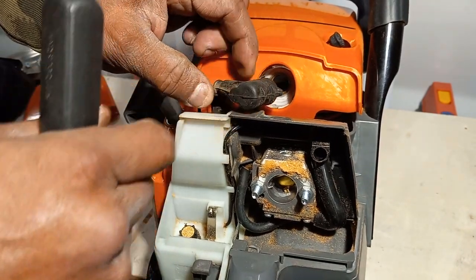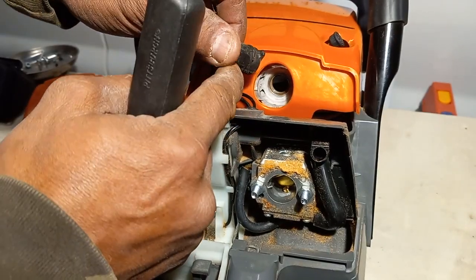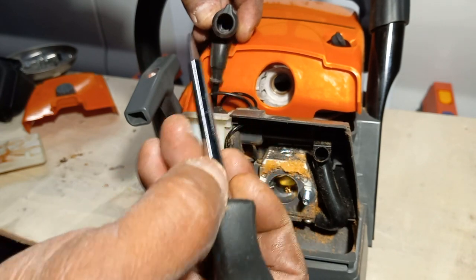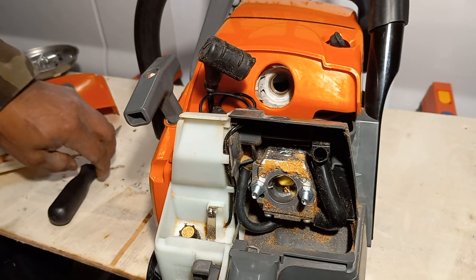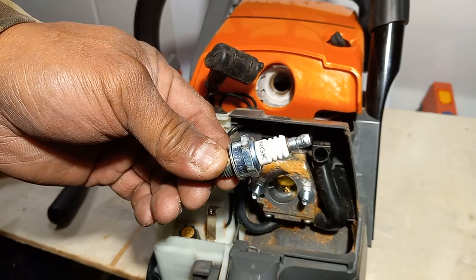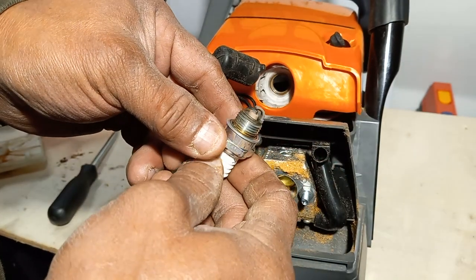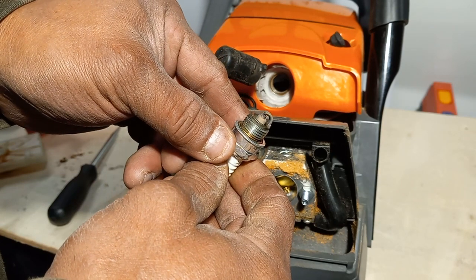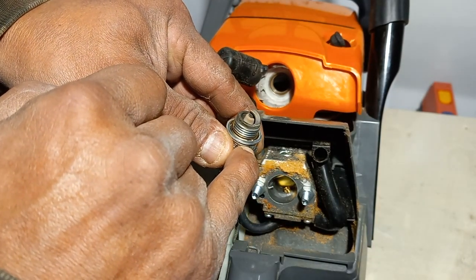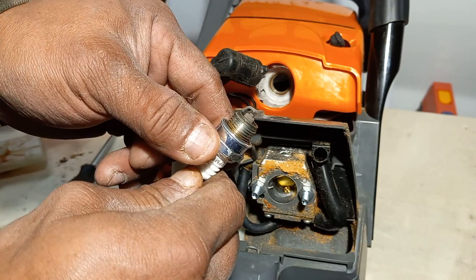Also in removing the spark plug — a lot of times on the Farmer Tech saws when you go to pull the spark plug boot, the boot will come off and it's a pretty big pain to get it back on while also conserving the contact electrode on the inside. This one came off typically for a normal spark plug boot. As you can see, that is an NGK plug. Even though I've been running it at 25 to 1, that's a little on the brown side — but the chalkiness, it's a little on the white side. You can tell by the contact electrode that it is a little lean, and that could be that I over-rev them quite a bit, but this is not bad as far as I'm concerned.